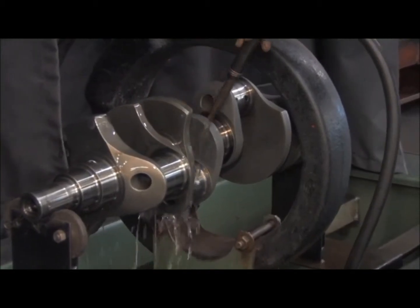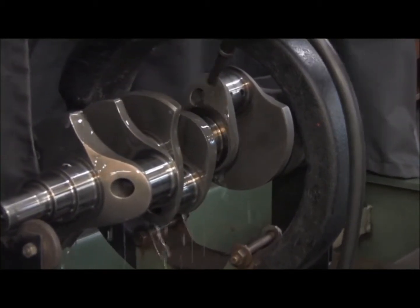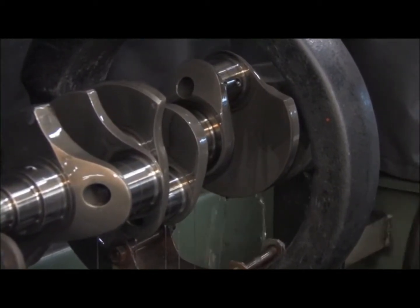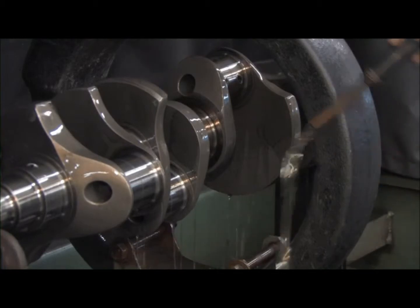The tent is pulled over the work to bring darkness, and a black light is shined upon the work. If the shaft is cracked, the fluorescent filings beneath the black light will show a definitive line. By doing this process, it ensures that a crankshaft is not installed on the verge of failure into your engine. All diesel engine shafts require magna-fluxing. Gas engine shafts remain an option to the customer. Magna-fluxing is a low-cost way to ensure your engine from failure.